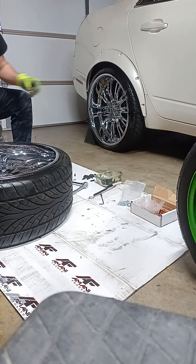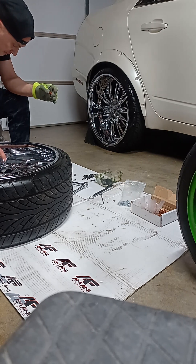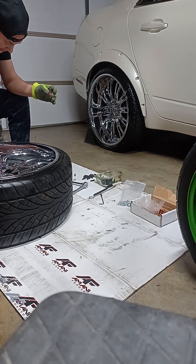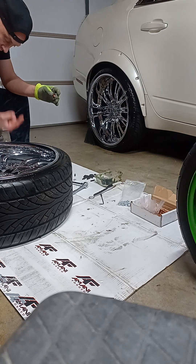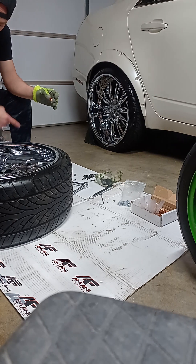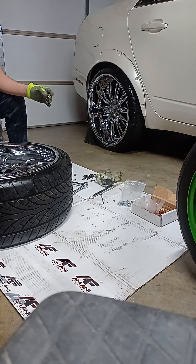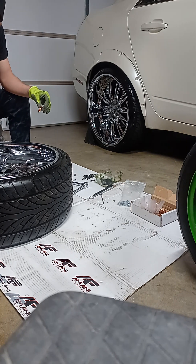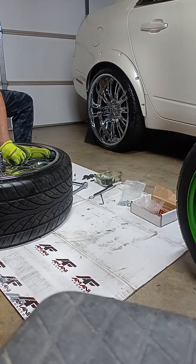You can see these pieces meet up — they're tough. The way it's machined, once the pieces hit the register at the center part, you can see it's solid in there. If you have a bent piece or something's wrong, you'll see a discrepancy — part of the sandwich will be hanging out the side. So once you drop the face in, connect on the other side with your nut and just hand-tighten it.